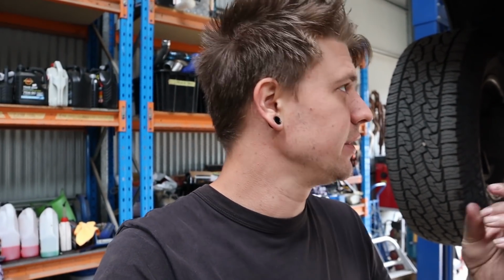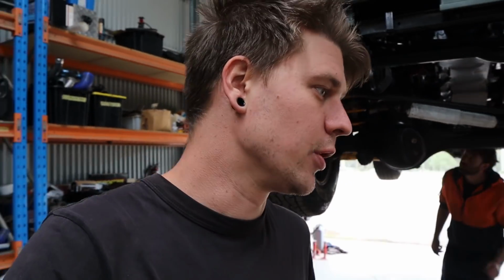Another thing I would like to point out as well, this thermo fan setup and this radiator just work amazingly. This thing will run at 102 degrees, and the hot tank on the passenger side, you can't even touch it. And the cold side tank, it's cold. You can feel the heat coming out of the thermo fan on the passenger side, and then the air coming out of the thermo fan on the driver's side is just cool. It's incredible how well this massive radiator and these fans are working.